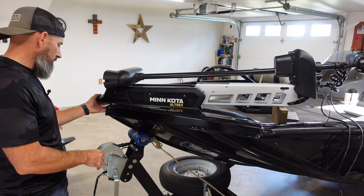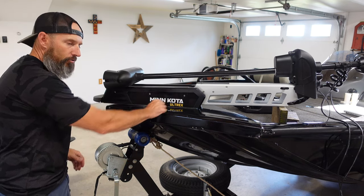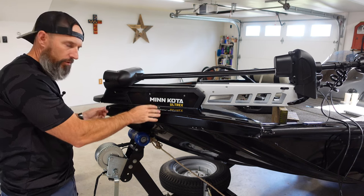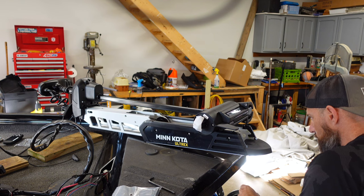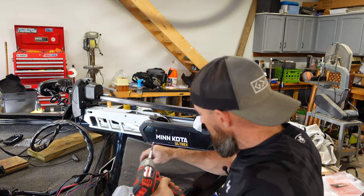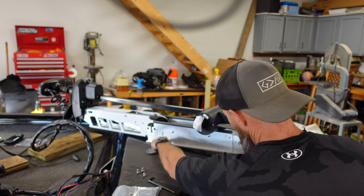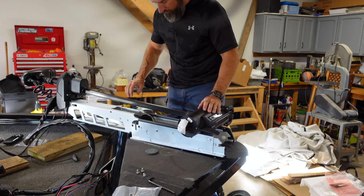So right now it's definitely going to be way more than an inch and a half because the shaft is going to come down right at the point of this. I could move this thing way back. I'm going to try to see if I can hit any of the existing holes so I don't have to drill a bunch more. When you have this up, get the shaft about an inch and a half from the boat, put a couple little marks on your boat with a pencil so when you open it back up you can put it back on them marks. A whole bunch of holes are lining up — that's what I'm gonna do.